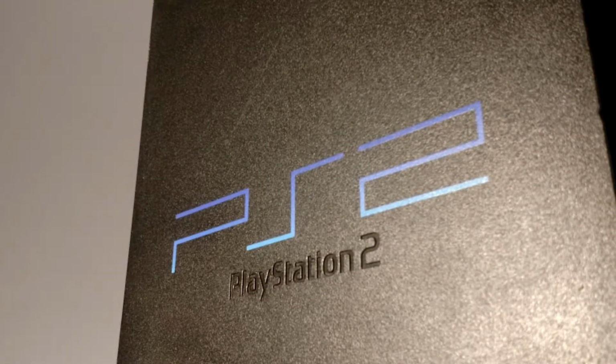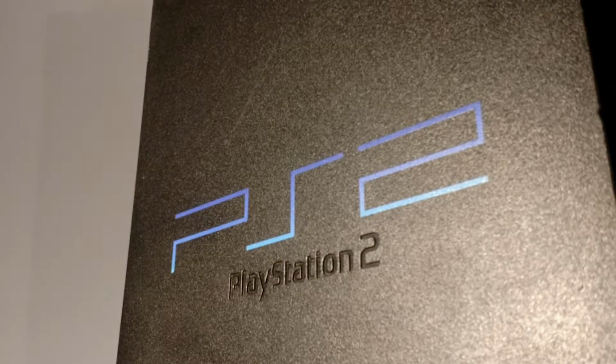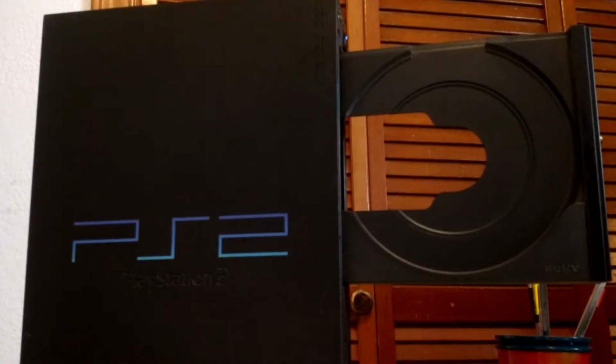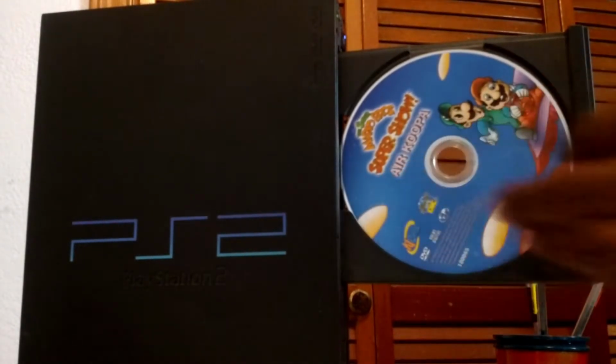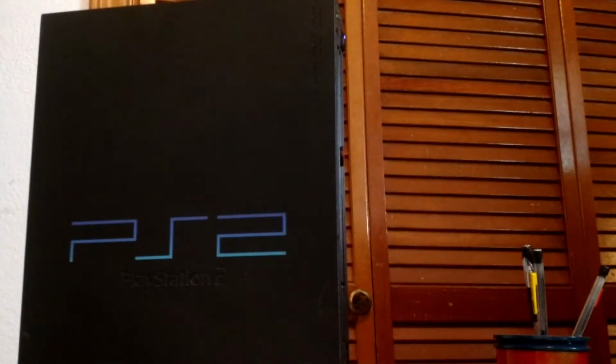Anyways, the PS2 packs in a whopping 294 MHz CPU, which boosted up to 299 MHz on later models, 32 MB of RAM, a 147 MHz GPU, 4 MB of VRAM, and a DVD-ROM drive. All of this would have set you back a whopping $299, which, as expensive as that sounds, one of the best selling points of the PS2 was that it supported DVD-ROM and music CD playback. If you look up the original MSRP for DVD players around 1999 or 2000, you'll see why this was such a big deal. Not only were you getting a killer gaming machine, but you could also watch movies or play back music for about a fraction of the price of what a home DVD player would have cost.